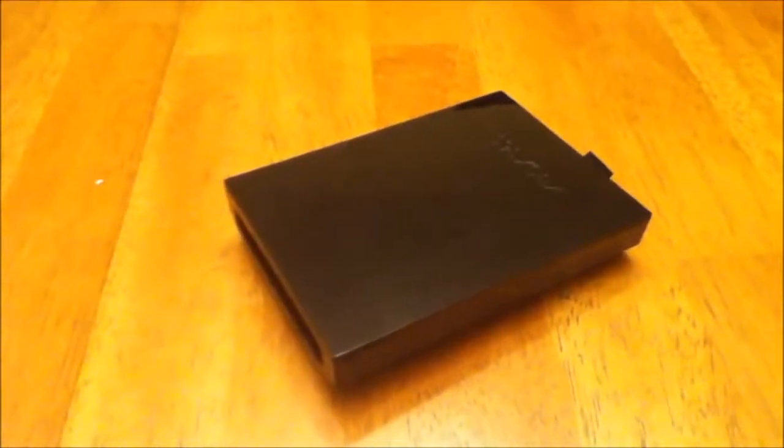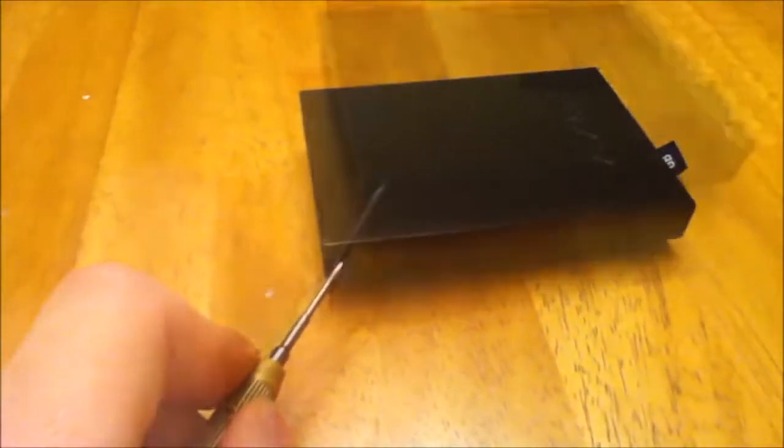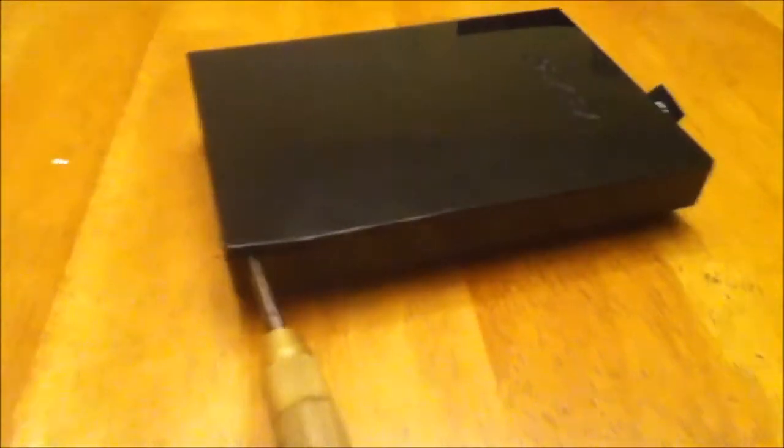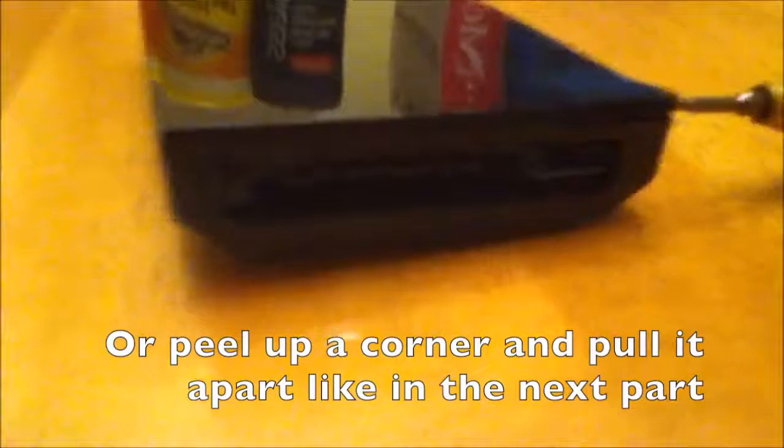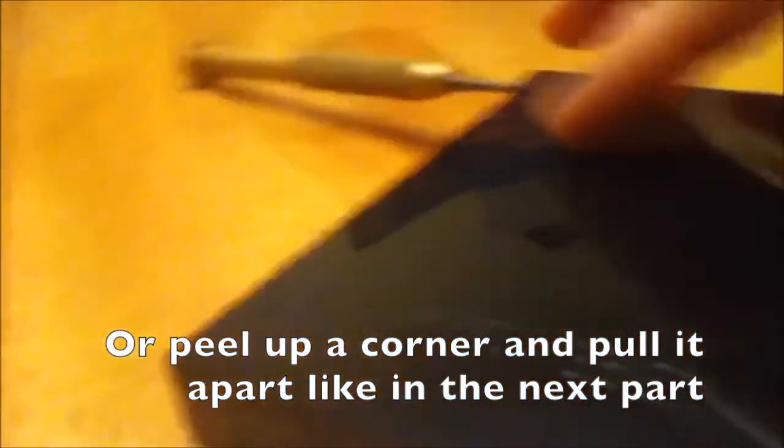Let's start with the 320 gig slim-cased hard drive. To open this case it's a bit challenging. There's an edge all the way around where the two halves meet. Since you don't need this case, you shouldn't really be worried about damaging it. You just need a flat head screwdriver — find a corner and work the screwdriver around. Once you insert the screwdriver and get it in, be careful. The top of the drive is very exposed to the screwdriver, so don't angle down and damage the drive.